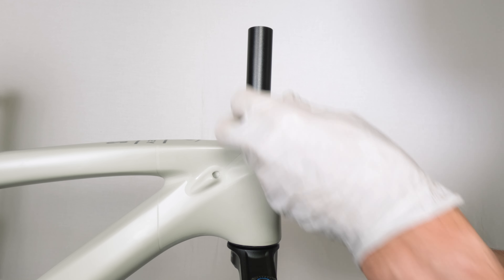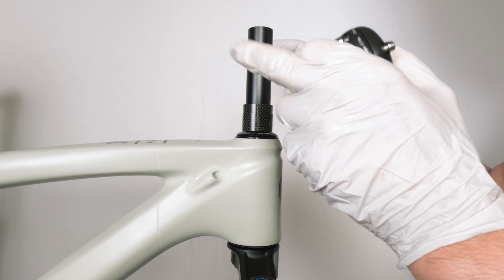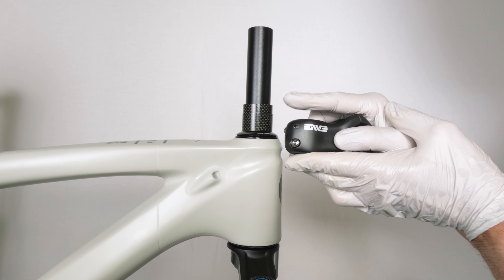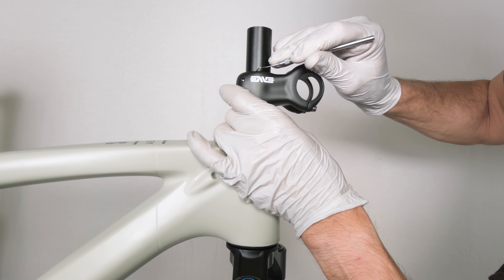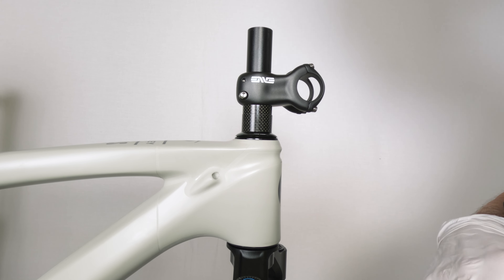So to make my life easier right now, I'm going to put these two spacers. Reality is you should never have to go above 20 millimeters — if you need to go higher than that, just get higher-rise bars. The extra 10 millimeters is only to have an option for a different stem in case a newer stem has a thicker height. I'm going to take this stem, slide it in, grab my pick, make sure it's all compressed, and put a score mark right there at the top. Now we take it all apart and start cutting.